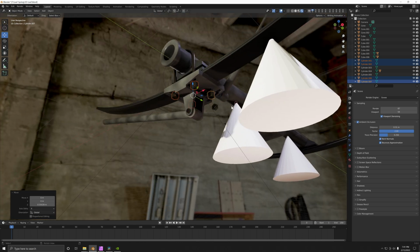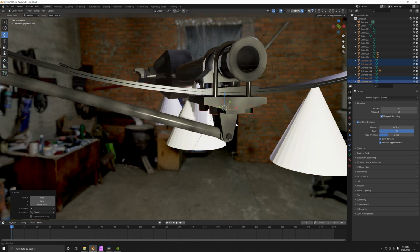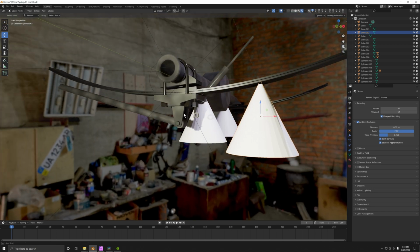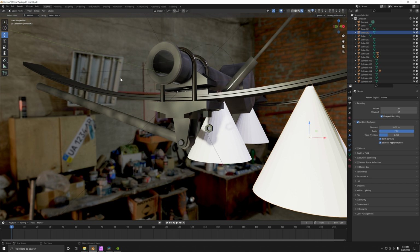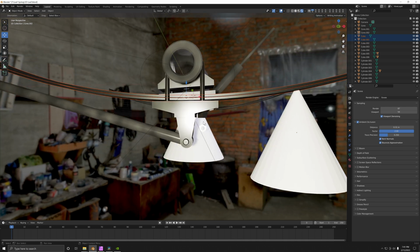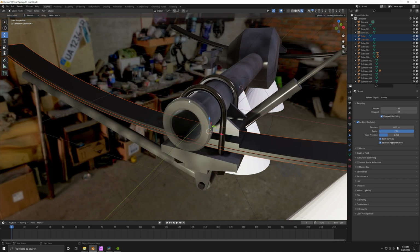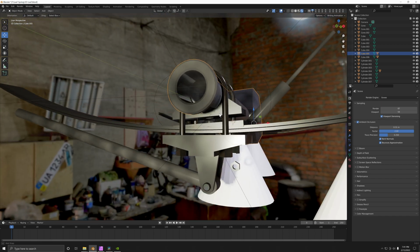Get them all secure. So that way, if your jack decides to slip, it won't unload and cause some serious injury. Because this is dangerous, guys. I'm going to tell you, these leaves, when they're loaded up, it's like a bow and arrow, and it will sling stuff at you. So make sure these guys are threaded up pretty good first around your differential right here. So that way, it's not going to go flying anywhere.